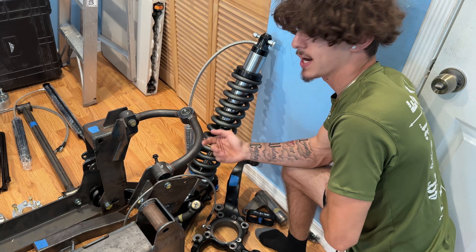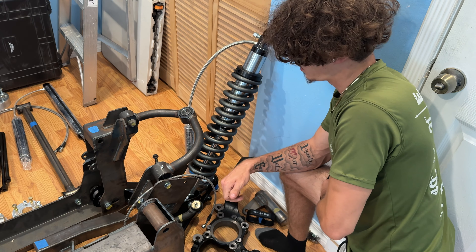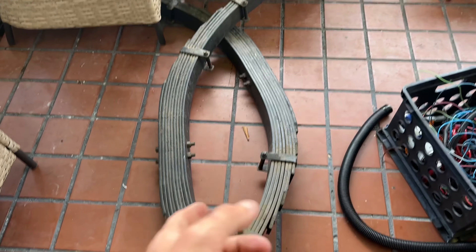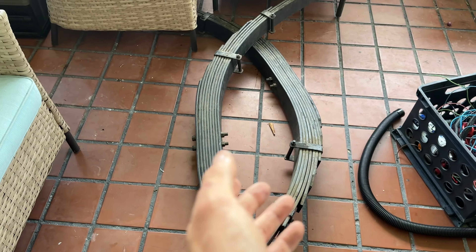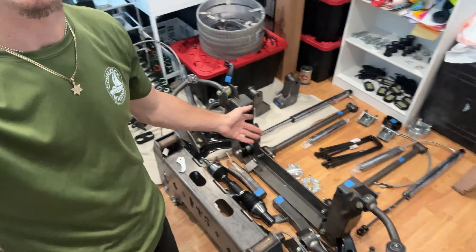You might be asking yourself: how am I going to turn this 15-inch lift kit into a 20-plus-inch lift kit? From the top of this bracket to this bolt hole is seven and a half inches. If I set these adjustable coilovers to 14 inches of lift and then add these seven-inch conversion brackets on top, I will have 20-plus inches of lift. The control arm angle will be perfectly fine because the bracket drops them back to stock, and a five-inch difference isn't going to affect the downward angle harshly.